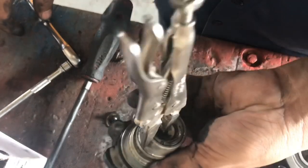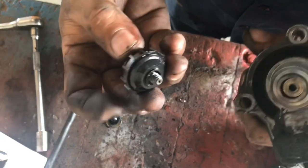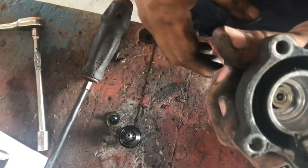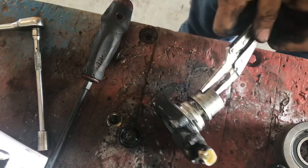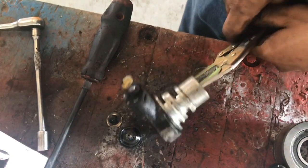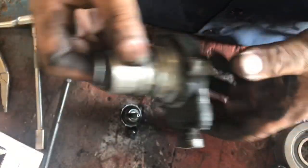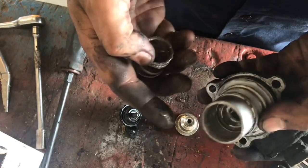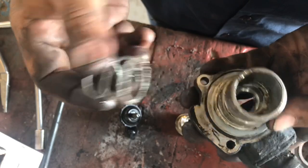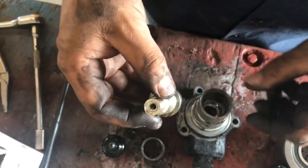Figured it out — vice grip pinching that little piston in place. Allow me to take this little 10mm off. This is the release valve. If you're ever wondering — whenever you pull up next to a semi, bus, or anything with air brakes, and you hear a burst of air — well, this is the valve that actually does it. It'll keep your system from building up too much pressure and it'll shoot bursts to get rid of some of that moisture. Look at that — it's water. So that dryer receiver — that little dryer is gone. I'm going to go ahead and place an order for that one and get to it when the part comes in. I just wanted to tear this apart and show you guys how these little suckers are put together.